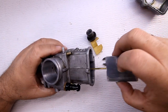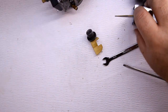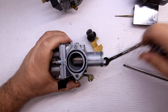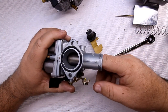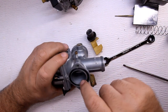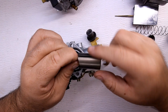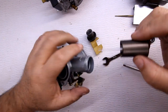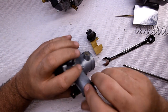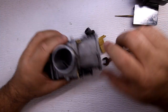Air only flows between the slide and the bottom of the carburetor intake. If you look at the round ones — it's a cylinder shape but there are no wings on it, it's just round. So air does flow around and bypasses around the sides of the slide, which does not make it as accurate as the flat slide carburetor.